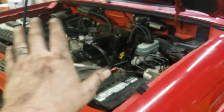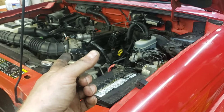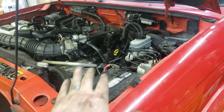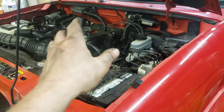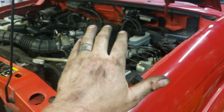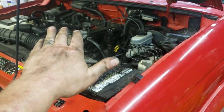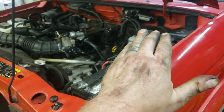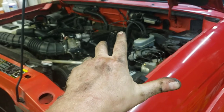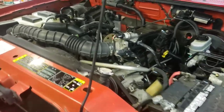She may be good to drive. I'm sure it'll have to go through a learning process. I may disconnect the battery, let the computer reset, and then go through a learning process because those are going to flow so much more. I'd rather put the fuel trims back at base value - it'll start over and then adapt from there. I'm not sure if that's how this one learns, but it could be. I'm used to old school stuff like my old school Ranger - you disconnect the battery, it puts the computer back at base level trims and then it adjusts from there. Let it heat cycle and then check the bolts and see how she does.